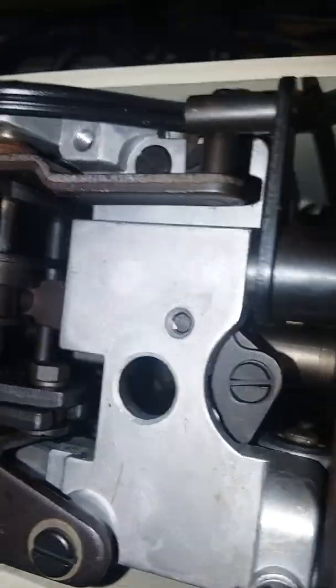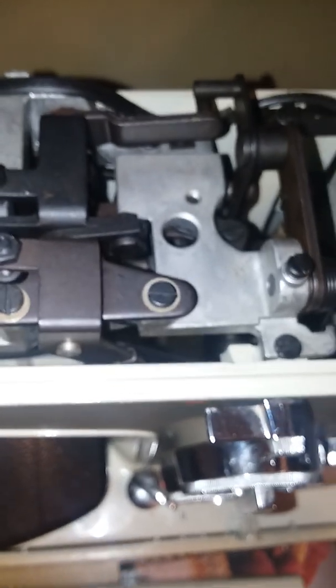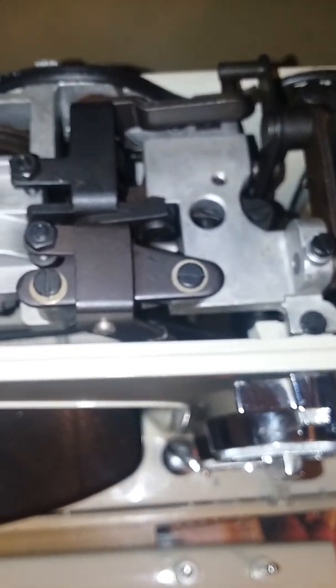There are a lot of different places to oil in here to get freed up in order to get the zigzag mechanism going. I have a 1430 that had the zigzag stitch width mechanism frozen up, but it also had so many other parts that were missing or broken that we parted it out. If I can show you some of the problem places, I'll try and do a video of that. Hopefully this helps you see the way the parts should move so it tells you where you need to clean and oil.